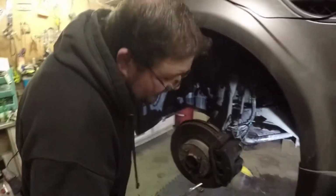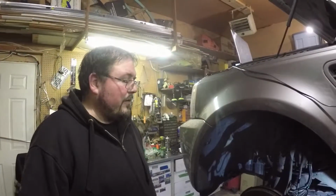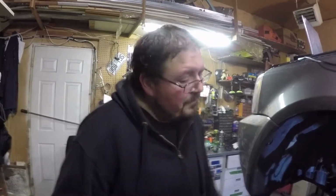We can heat up the outside of whatever's holding it, which is the sleeve. Then it should expand some and hopefully be able to break loose the bolt. I know some will say, why bother? You can just cut it, but then you end up with two pieces that you have to fight with to get the bolt out of both sides. So that was my option.